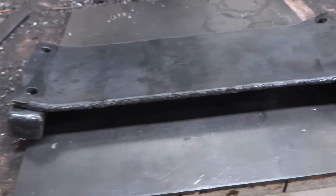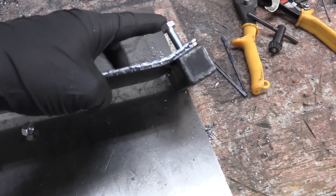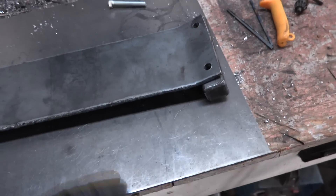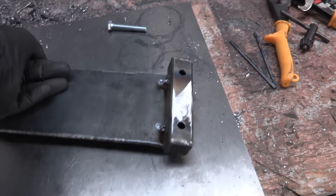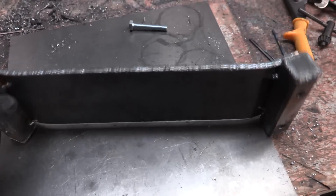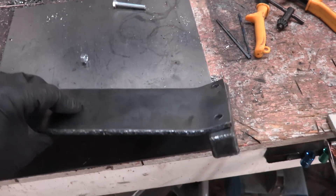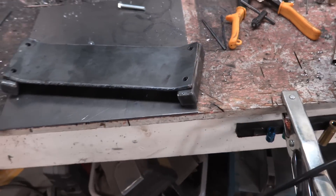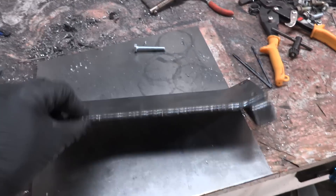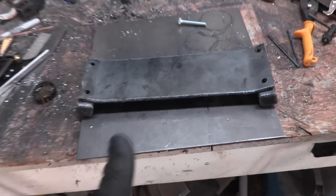Progress — this is all welded up, you can see the seam is welded on both sides, and the holes are drilled for the hardware. Next step: go back under the car and weld these two guys into the transmission tunnel. It's going to suck because I'm using the MIG welder upside down so a lot of it will fall on me, but I'm using it because it produces a little less heat. Fingers crossed — don't catch the car on fire, don't burn myself too badly.